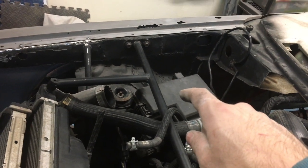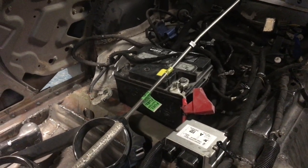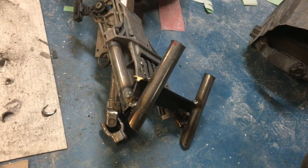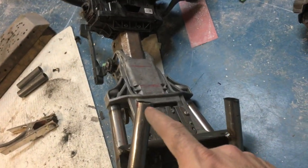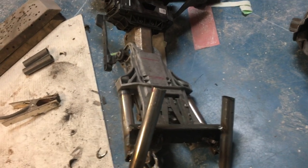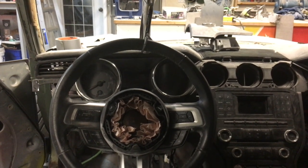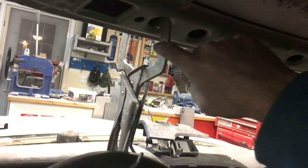Tony's been relocating the battery. Right here is our engine bay fuse block — that's where the battery fuses sit. He stretched them out a little bit and we're thinking we're going to have the battery behind the seat. We couldn't find any racing rules where it's against having the battery there, and we'll put it in a box. I've trimmed down the column supports — the ones that were really long — and welded little braces on this way and along here. We'll have a bar that goes across where our dashboard mounts.